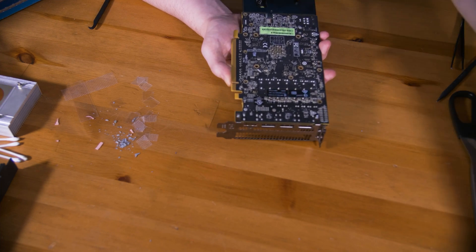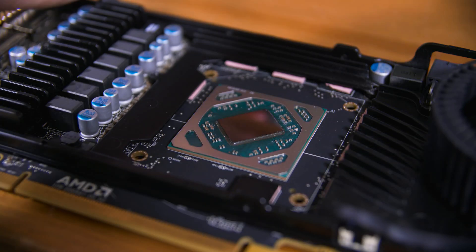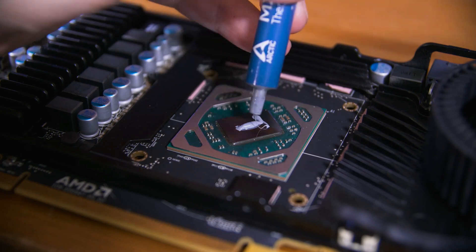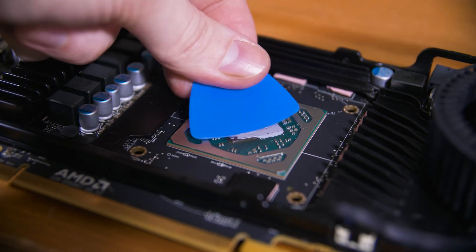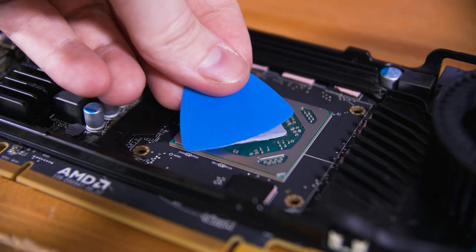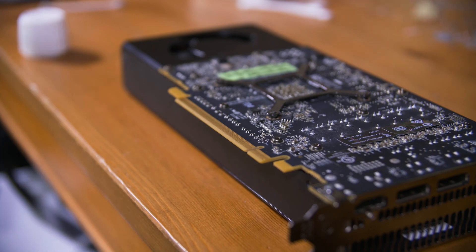It's a good idea to gently put them all in and then come back and tighten them later. Next comes the new thermal paste. You can do this like the factory did — just dump a daub on, stick the cooler on, and hope it spreads itself out evenly. Personally I prefer to apply enough paste and then use a plastic spreader to even it out so that every part of the die is evenly coated. That way when the heatsink drops back down onto the die it'll have a nice even layer of thermal paste beneath it, rather than having to spread it out and potentially oozing off the sides or missing parts of the die.